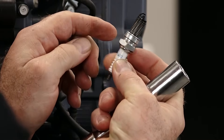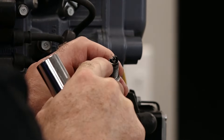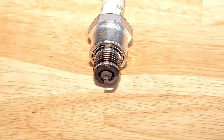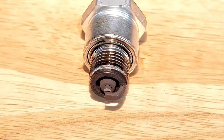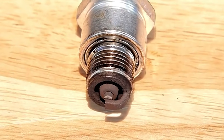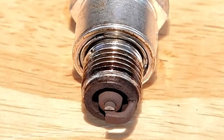Now the other thing you might see is carbon on the electrodes. That can mean your motor is set to run too rich, but it can also mean you've got something else going on inside of your intake that's restricting the air from getting down into the cylinder, which by extension also ends up causing it to run too rich relative to what the available air is inside the cylinder. That's a long way of saying something may have built a nest in your intake and you need to make sure that it's clean.